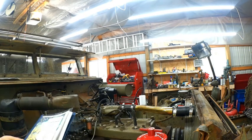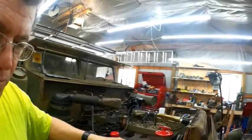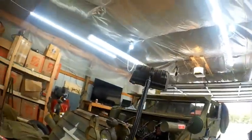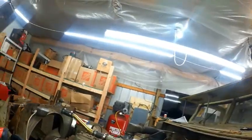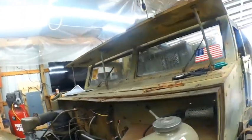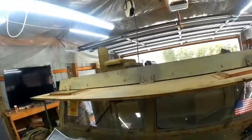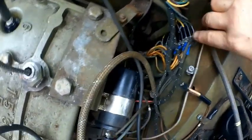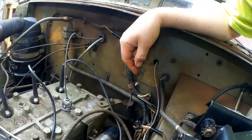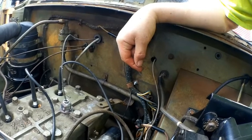And the one thing that really threw me off is my rear harness has actually 12 wires coming up. Correction, 11 wires coming up and 10 slots on our tab here. This is the tab we're talking about here. It's an insulated tab, so the rear wiring harness comes up here, ties into your harness going into your dashboard. I had one extra wire coming out of that harness that I could not account for, even doing a continuity check with all the other wires in the back.